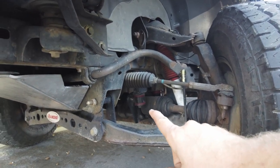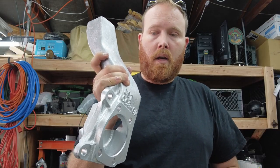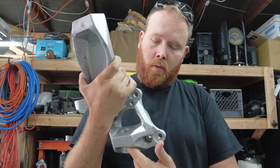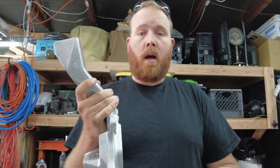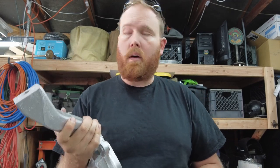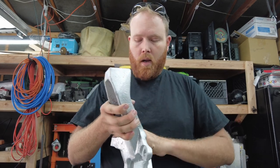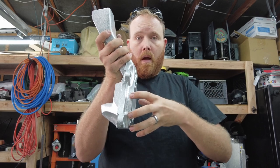You can see the drop brackets on the front differential here — this is a five-inch CST lift. Basically, you can't get a CV axle through the middle, so it's not compatible with a four-wheel drive spindle like the one on Ryan's Canyon. What CST did is they took the ball joints and the tie rod and kept them in the stock location, then just moved the hub down five inches. That's how you get your lift.